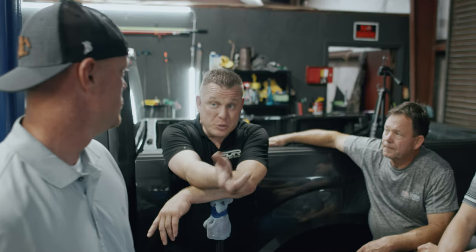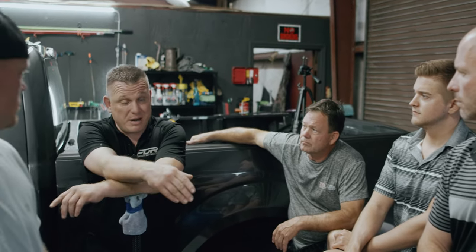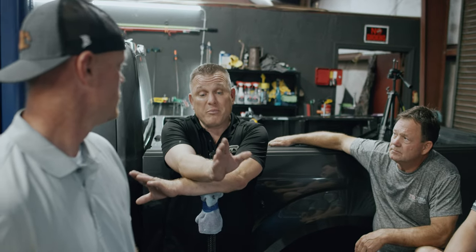The only thing about the back one, I would say that ridge around it, that circumference, that's dangerous. Yeah, full paint. Honestly, that's a slow controlled pull at that time, and you're working around the edges. It's just volume displacement. As it's coming out, you're pushing in. That 200 degree point that I just taught you is the safety point. Here's what you don't want to do: I've got in excess of 286 degrees Fahrenheit on non-built paint. But if it's a tri-stage pearl, don't even get near 250.